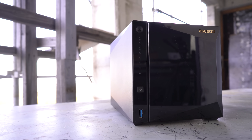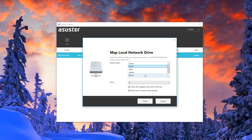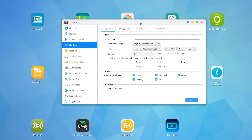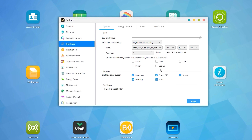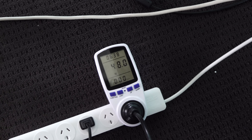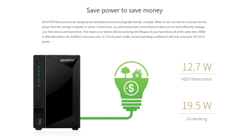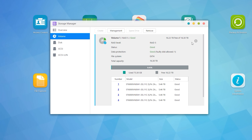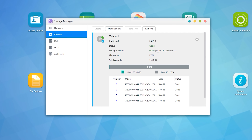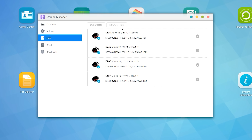You can remotely access your files via a WAN address by setting up a user login, and individually map separate user profiles, as well as control LED brightness. You can actively monitor everything from different computers simultaneously, supporting up to 512 connections. It also supports iSCSI, and you can configure hibernation settings — power consumption is around 50–60 watts with all four drives in use, but drops under 10 watts on hibernation, which is very impressive. You can also schedule daily, weekly, or monthly health checks and drive optimization scans, plus get a readout of drive health and estimated remaining life.